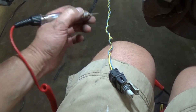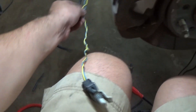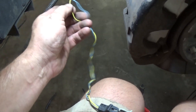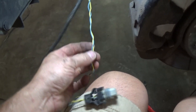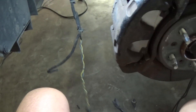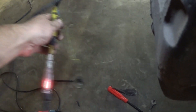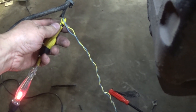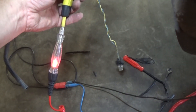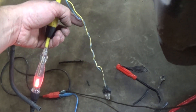Unfortunately I need to pierce the wiring until I get to a good ground. I cannot find where the wire is broken. I have to do some more digging. I've got my piercing probe maybe 10 inches or so from the connector, and I have ground there. So from this point down to the connector, my yellow wire is broken somewhere.